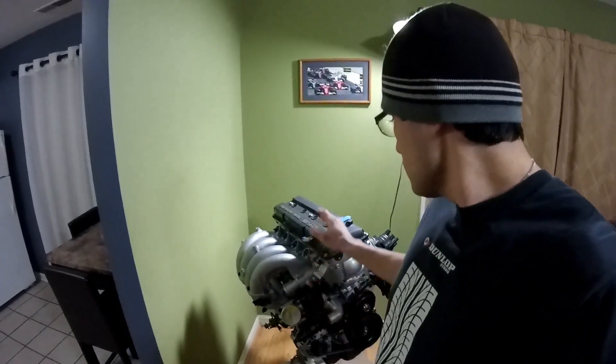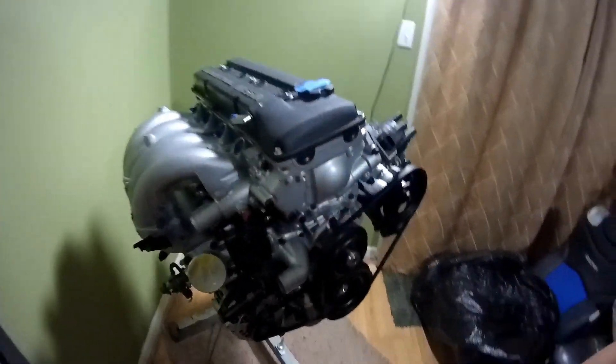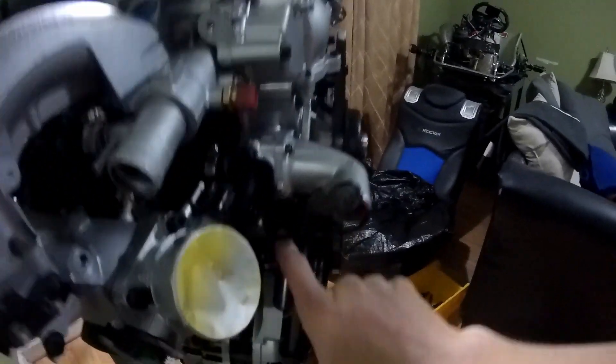The PCV tank's back on, obviously the valve cover's on, distributor's in. I think you saw me down there struggling with the top bolt in here - it's hard to get a direct shot at. I think I started to cross-thread it a little bit when I was getting it in there. So I went and switched it - first I had to get a tap, run a tap there just to clean it up a little bit in case I did cause any damage. And then I got a bolt that has a Phillips head cross into the head of the bolt, so I can get in there with a screwdriver and let the bolt kind of find its home, versus using the socket where it might be off track. So got all that figured out.